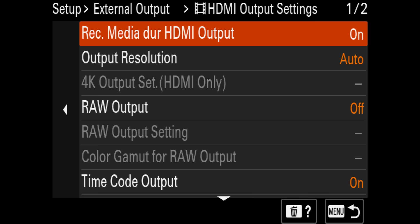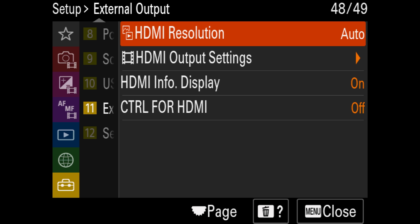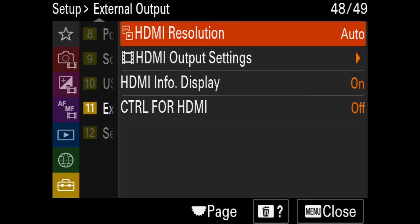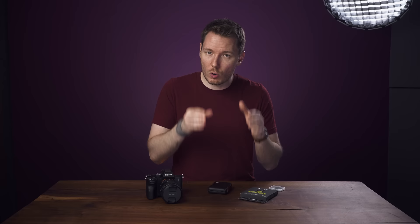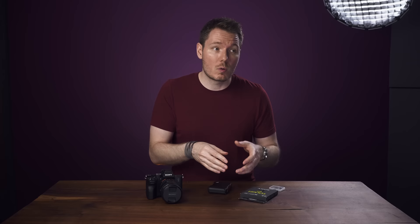I also want to give a tip when it comes to setting up your HDMI output. You'll notice there are two output resolution options — one in the parent HDMI settings and then one deeper under HDMI output settings. The top directory one is for photo mode monitoring and playback, while the more nested setting is for video and has the film strip icon next to it. This second one is more important, and depending on the device, leaving it on auto may cause problems such as outputting the wrong frame rate. You might have to go in there and manually set it to 2160p to get a proper 4K recording on an external device.